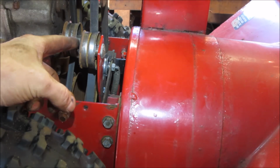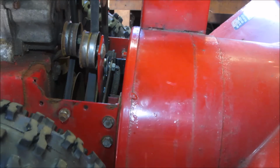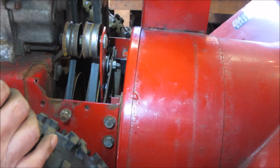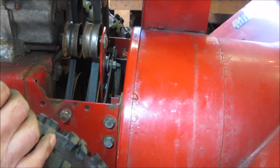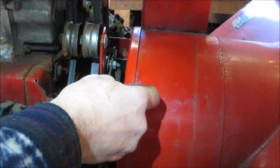We're going to go run it and make sure that the belt stalls out and the auger stalls out and all, and that it drives okay too. The tensioner is about in the middle. I'm going to run with that, and I can still adjust the cable, how hard the cable pulls on it, but I think that's a fairly decent setup.